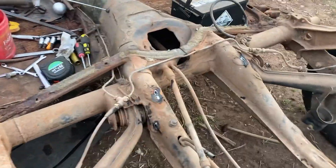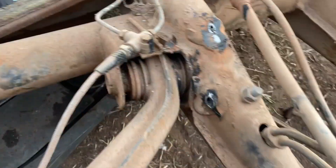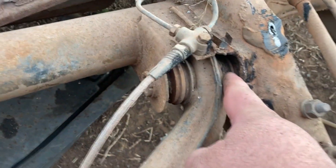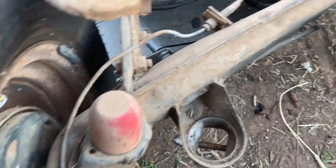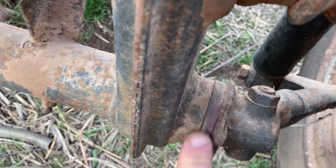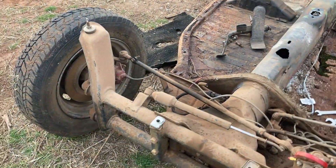I've ground the emergency brake cable housings off smooth. Years ago when I first built this chassis under the bug, I pulled the trailing arms — and this actually has Bug Pack red polyurethane bushings already in it. I put red stoppers on it, and in the front it has red bushings on the arms themselves. I also put a red steering donut on it and a disc brake kit on the front.